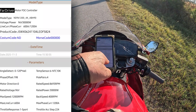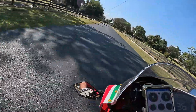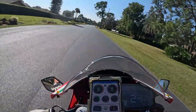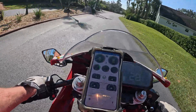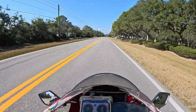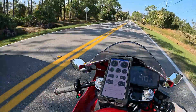Let's go back, get the battery charged again, and do the same test with field weakening on — it should go above 87 miles an hour. I just had an epiphany. One guy in a comment told me it doesn't matter how many amps I have — 600 amps, 300 amps, whatever. Once back EMF and EMF are equalized, that's all the amps it's going to pull. I'm back at 103 volts exactly. In the last run, I was stabilized at 87 miles an hour, 10,000 RPM, and 270 line amps. So I've set 270 line amps as my maximum amps now, and I'm going to see if I can get those same numbers.